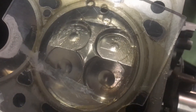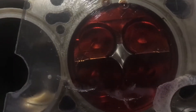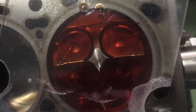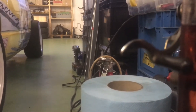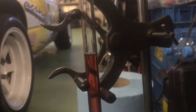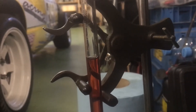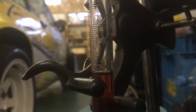The chamber is full now. I'm just gonna wait a little bit because the fluid will take a while to settle. After a little while, I call this 42.6 cubic centimeters for the new piston. Next I'm gonna measure the old piston — 44 and a half for the old piston design, so it is actually more than I would have expected.